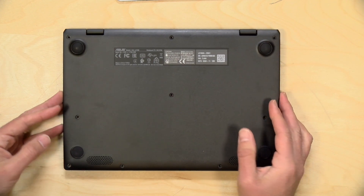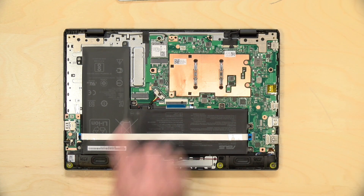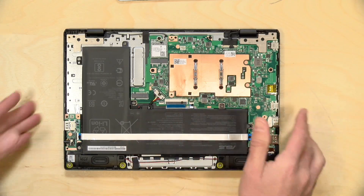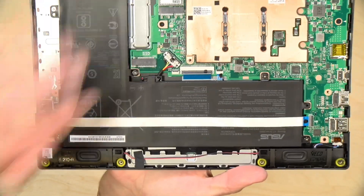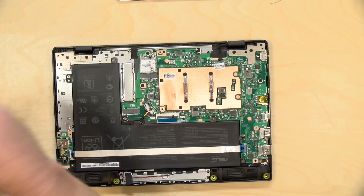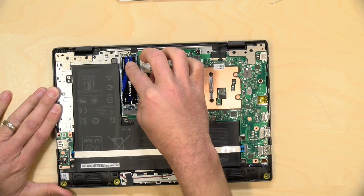It wasn't too hard to get into it. We just had to take out all of these screws, and inside you can see what we've got here. The Wi-Fi card is something called an Azure Wave AWCB304NF, in case you're wondering what Wi-Fi is in there, but it looks like you could upgrade that to something else if you wanted to. You can't upgrade the RAM on here, but one thing I noticed right away is that it does have an NVMe slot here labeled SSD. So in addition to that 64GB eMMC, I'm going to take a spare NVMe drive that I had laying around and install it now, just to see if we can make use of that.